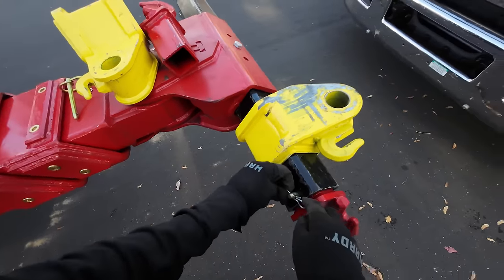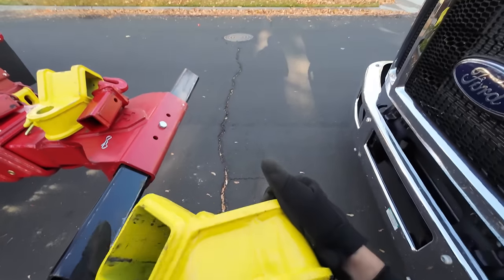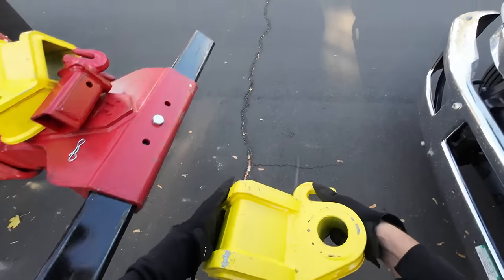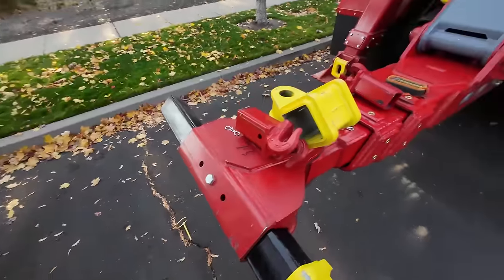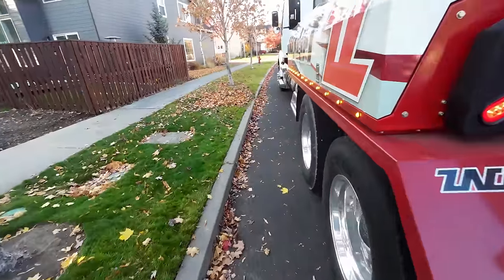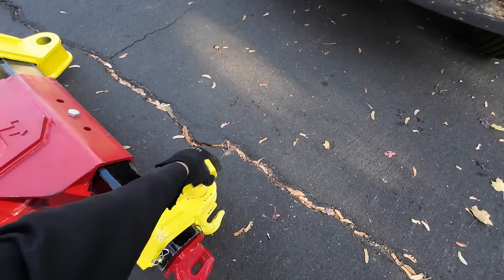Yep, super low. What I'm gonna do is flop these side to side in 180. You can see now they sit up high, and if we bring them, well, we could just turn them over, but they're offset, so now they sit way in. But if we just bring them to the other side, now we've got our wide grab and they sit low. So I'm gonna back up like a lot, but first I'm gonna drop my forks in so they're already there.